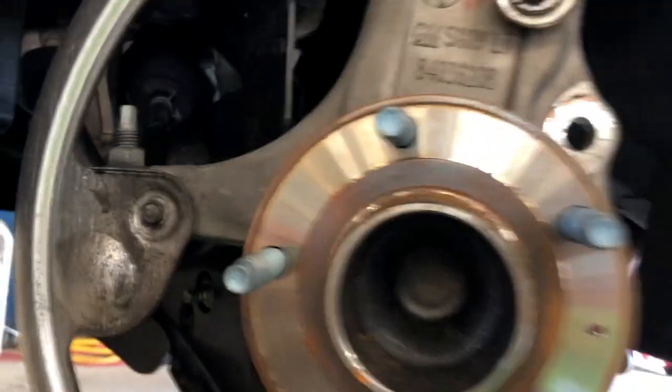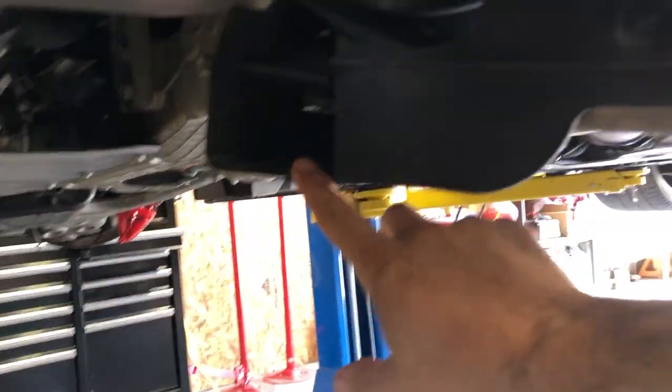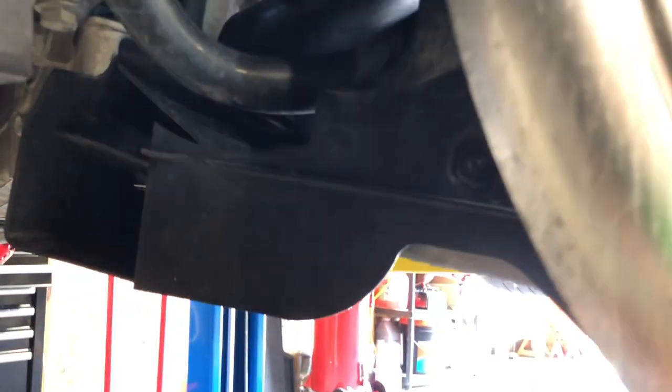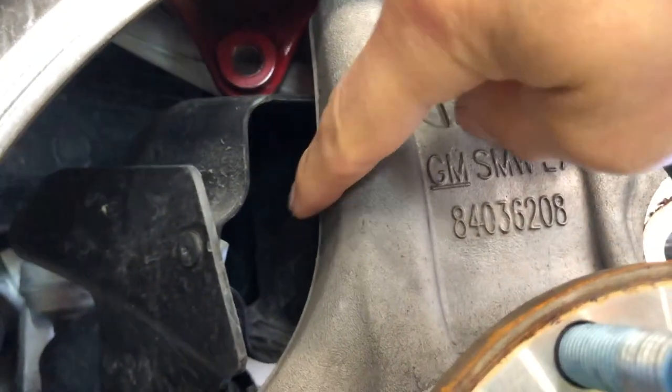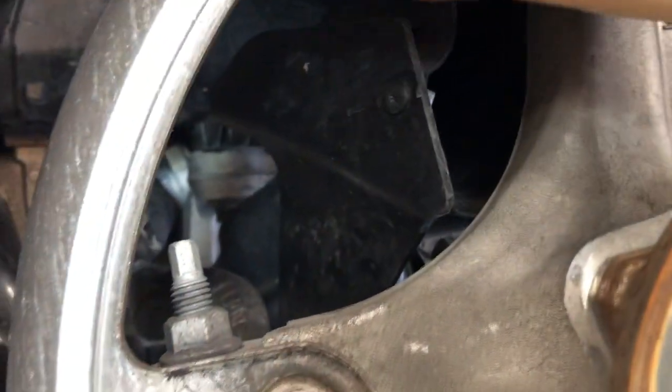The point of this is you can see, when you've installed the race ducting under the car, there's actually a small duct. This is the front — these little scoops stick down here. This duct, which comes with those cooling rings, goes up over around the suspension and dumps out here. As this air is blowing out here under speed, this cooling ring curves back — you can see the curve. The air gets held back in here and it's supposed to expedite cooling of the rotor.